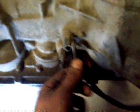When I was under the car, I wasn't sure how these lines came off. I just took them off where they were spliced — somebody spliced them at one time. But then I got to look at them and realized they were just push-connect fittings, and I happened to have the exact right tool. You just get it around there, push it in all the way, pull on the line, and they pop right out like that.